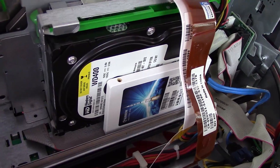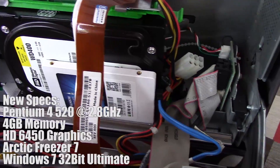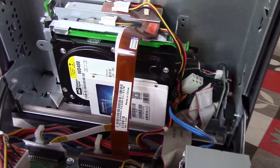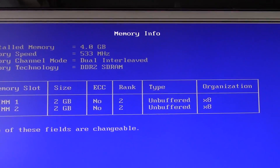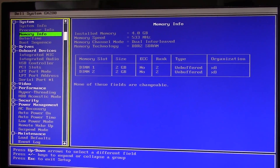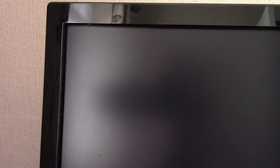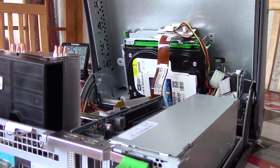I also added my cheap Chinese SSD to the equation, though as I'll explain later on this option didn't last long. With these somewhat ridiculous mods made, it was time to fire it up. The first thing to do was to ensure that the new RAM along with the processor was detected after fiddling around in the case, and looking back on it now I failed to realise that this 32-bit CPU with its 32-bit operating system would only recognise up to 3GB of DDR2. Also, while the SSD was detected, it refused to work as a primary drive no matter the settings, and the capacity is a little small anyway, so I swapped that back out for a slightly larger 160GB hard disk drive.